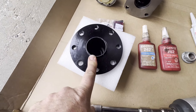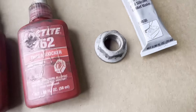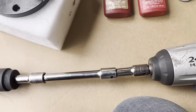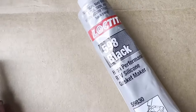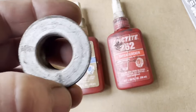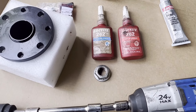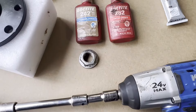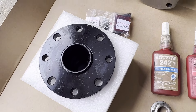To secure this yoke on the output shaft of the transfer case, we'll be reusing the inch-and-a-quarter nut. I have some extension set up with an inch-and-a-quarter socket. I'll be putting some red thread locker on the threads of this nut, and then some black RTV silicone on the flat portion of the washer. Then we'll install the yoke and get that tightened up. Adams says torque this nut to 160 foot-pounds, so I'll get the torque wrench out for that.